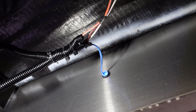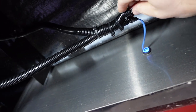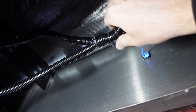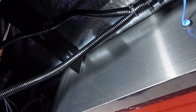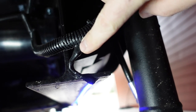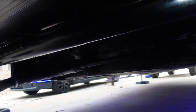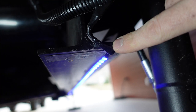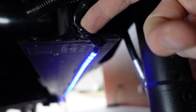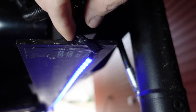Let's talk about some other considerations. Here we're back under the skirting at the backside of the blue step LED light. This is where the 12-volt from the BM Pro system feeds into the step light, and our newly added two wires run to both sides of the blue down lights. One goes inside this wire loom and comes out to the first LED strip, then continues to feed the other blue LED strip. The LED strip itself just has two wires — typically black and red; red is positive 12-volt and black is ground.